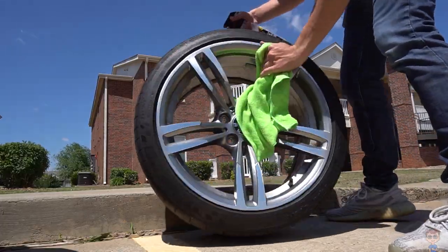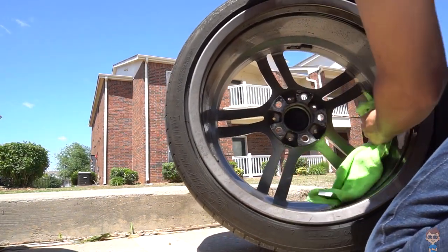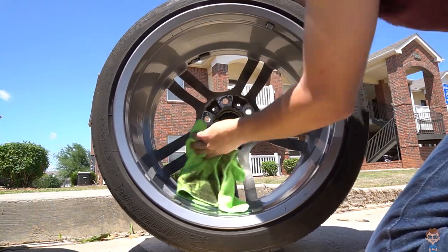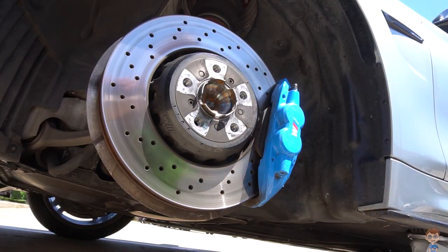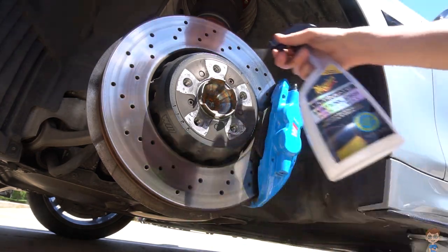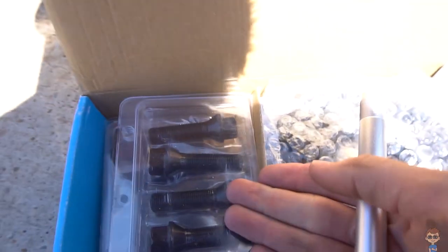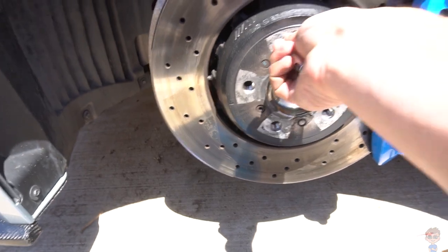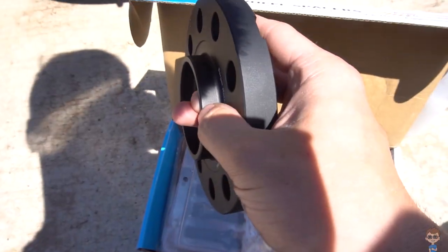Since it's a lot of work to get the wheel off, you might as well take the extra step to clean everything up — it makes me feel better about the whole job. Burger Tuning didn't only provide the bolts, they also provide an alignment tool that says 'Burger Tuning' on it. The whole purpose of this tool is to align everything to make it easier to do the wheel install with the spacer. You thread that in, then grab the 18mm spacer. You can also see it has a lip so it sticks out and supports the inner wheel.